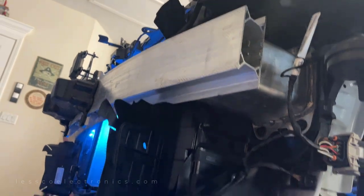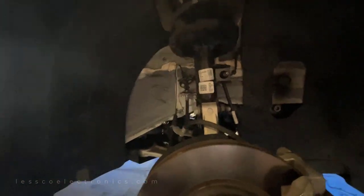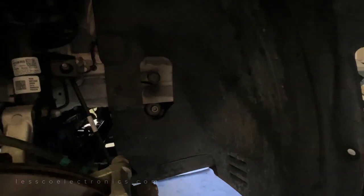So aside from the four lights up there behind the grill, I've got two on the front behind the front header panel mounted. I also did the front wheel well, which is mounted up in there with basically just hot glue, and I ran the wire right through there. It comes out the other side and back down under to connect to the other one. In here I sprayed rubberized undercoating so that when the lights are on you won't see the white backing. This is just rubberized undercoating — watch this. That'll dry up to a nice dull gray-black to match the interior of the wheel well.